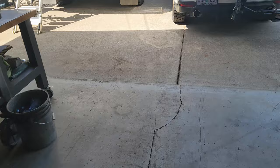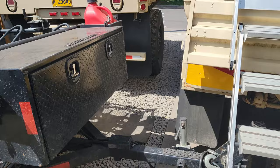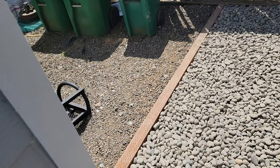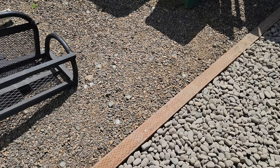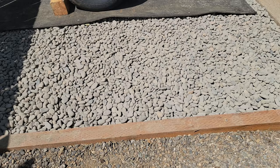So in other related news, I told you guys that something was going to happen over here, and it definitely did. So our handyman and his crew took out 8 inches of dirt, put a 4x8 pressure treated timber or board in here, or whatever you want to call it, beam, and then he rebarred 2-foot rebars all the way down it, so it's stationary, not going anywhere.